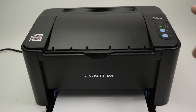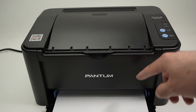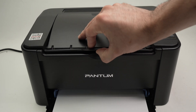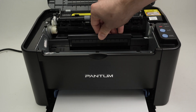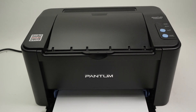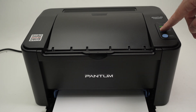Don't worry about that. All you need to do is press the Wi-Fi button once, and make sure you have some paper. But if the light over here is blinking, it won't work. What you need to do in that case is open the lid, take out the cartridge, put it back, and close the lid. Wait a few seconds — the printer will make some noises, and then the light will stop blinking. Now I can press the Wi-Fi button once.